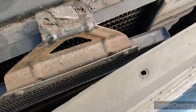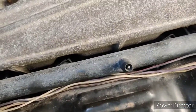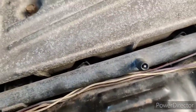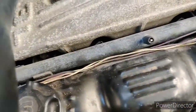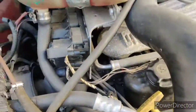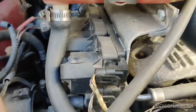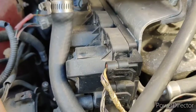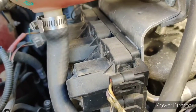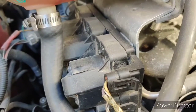I still have the AC compressor but I still need to put the condenser back in somehow and figure out how to fit it in there. Right now it's got the Neon injector. I had put in 35-pound Grand Prix injectors from a supercharged Grand Prix, but I took them out until I could get a new EEPROM programmer — mine took a crap. I'm using a lot of old stuff — that's a GM coil pack from a V6, 2.8 to 3.4, like '88 to 2005.